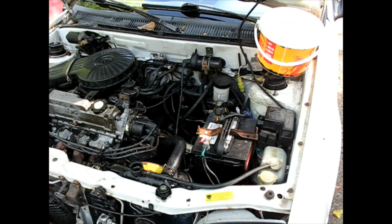That's my opinion. The backs of your core plugs, your freeze plugs, all those things are going to be touched by anything you put in there. So it should be pretty gentle, but CLR, I wouldn't call it gentle. So I want to just get this thing cleaned out. If it won't clean out, again, I have another one. So I'll just have to go at it the hard way, but I'm going to see what this will do.